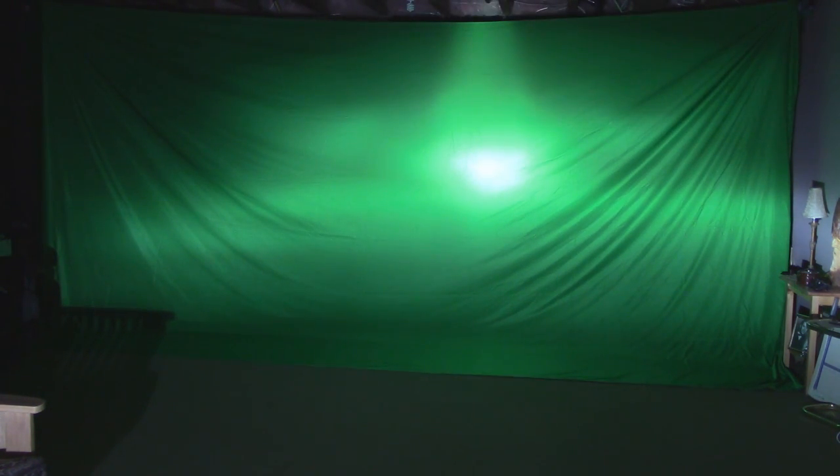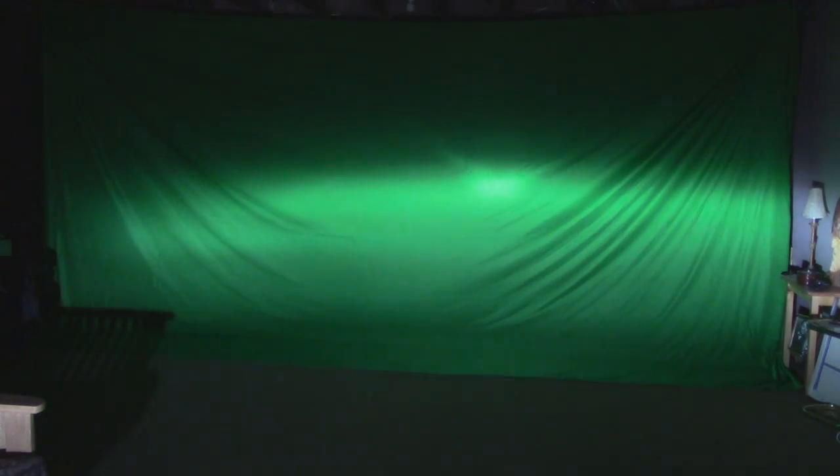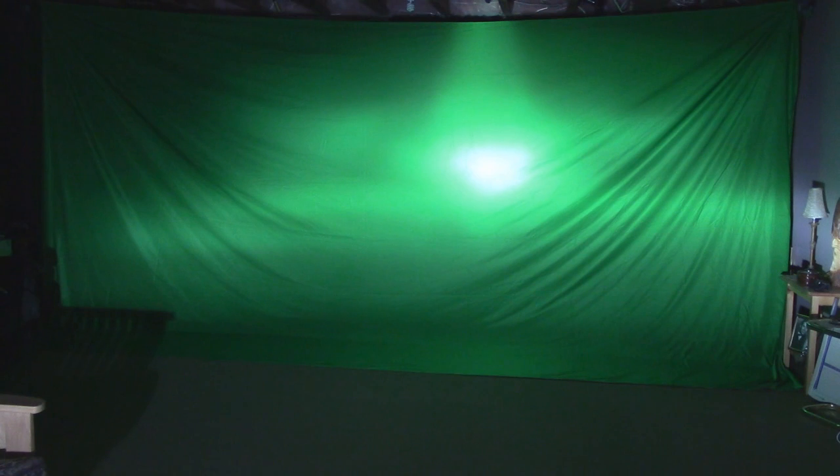Remember the time delay? Depending on where you live and how you ride, this could be good or bad. If you're driving in the city, your high beams are off and cold — if you have to flash at someone, this is what's going to happen. If you're in the country, both lights are hot and bright. If you meet an oncoming vehicle, you can turn it off, let them pass, and then immediately turn it back on — or if you have to flash your lights, you can do that. And this is exactly why the Victory headlight has an HID for the low beam and a halogen bulb for the high beam: it's instant on.